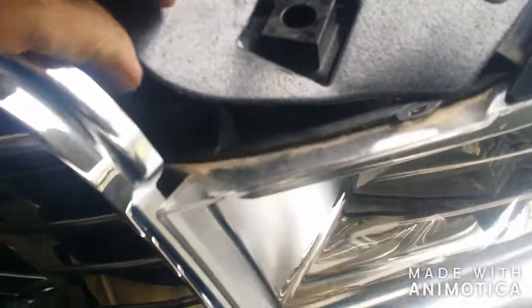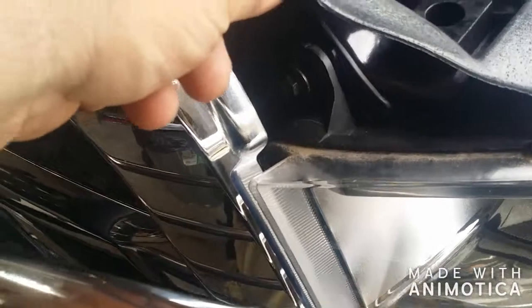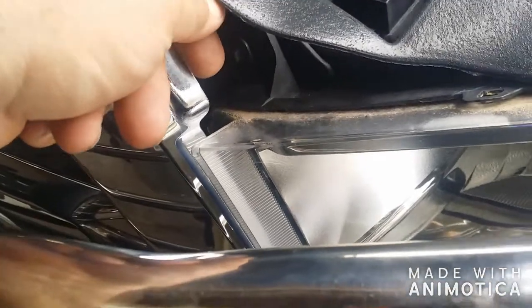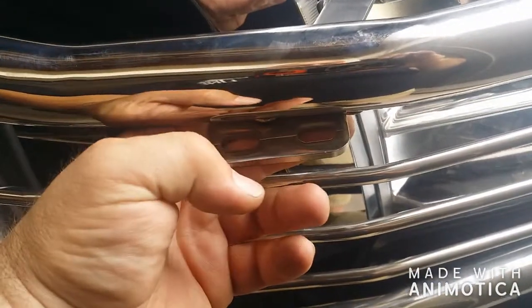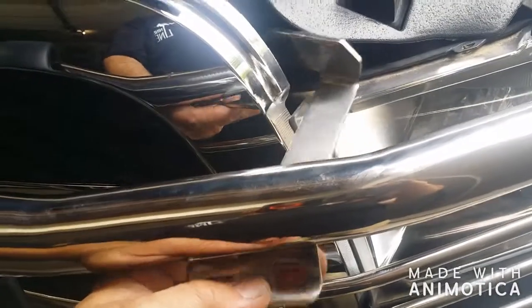For the last part, they give you these little bracket pieces. Pop your hood — there's a little screw right there, it's a 10 millimeter, and this bracket connects under there and attaches up underneath. It adds extra support and yes, your hood still shuts.